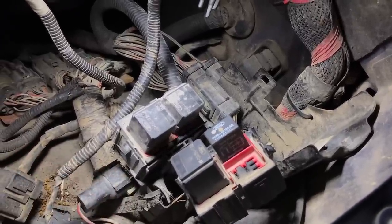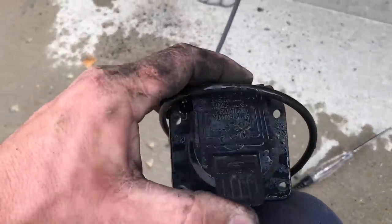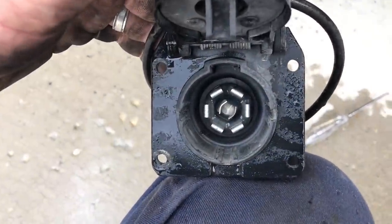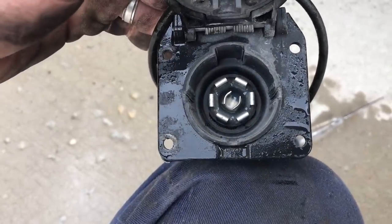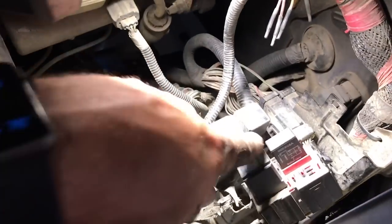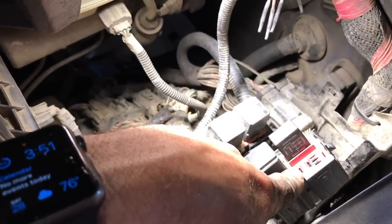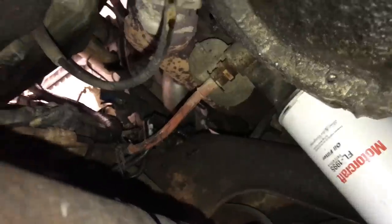Then it became a wire-chasing issue, which is really time consuming because it's hard to tell where the wire problem may be. The first thing I did was run a test wire from the trailer connector — the one on the far left that says left-hand stop turn — using an alligator clip all the way up to the front of the truck on the relay circuit. I ran it up to the plug on the switch side of the relay and had no continuity, so I knew there was an open circuit somewhere on the truck. I started crawling underneath, following wire harnesses, even without the Ford schematic.